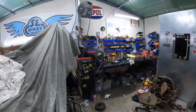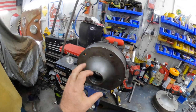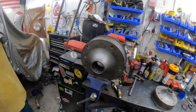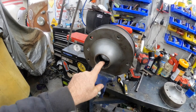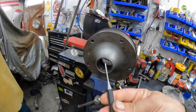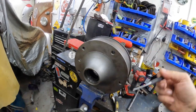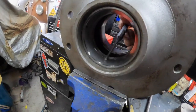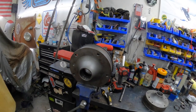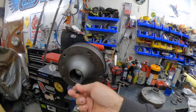I'll show you something I've got to do here. The specialist needs the new bearing races to be put in so he can spin the front drums and clean up the surfaces on the inside. I have to remove these old races. The normal way is to get a punch, come in on the inside where the lip is, and punch them out — except there's no lip on this one. So I was scratching my head thinking, how the hell am I going to punch this race out?